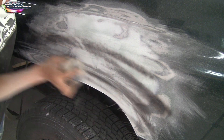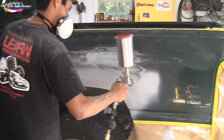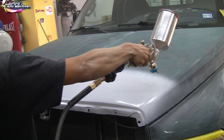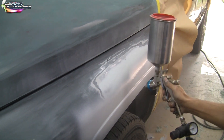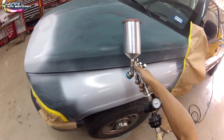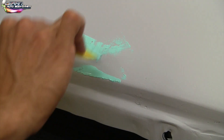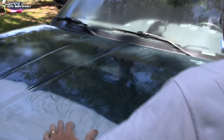After that's done, we're going to use a polyester putty and fill everything in really nicely. We laid about three heavy coats of polyester putty. Then you want to check for imperfections — if there are any chips you missed, fill them with a regular glaze putty. I use a polyester glaze putty in a tube. Then we cut everything down with 400 grit wet sand — you could use a DA to speed it up, then finish with a 400 wet sand and you're ready for paint.